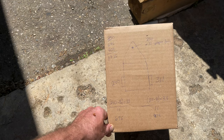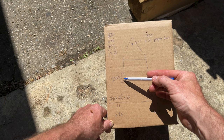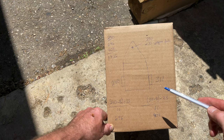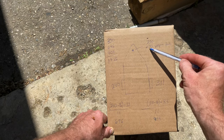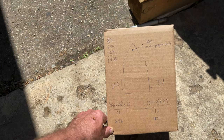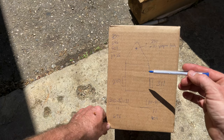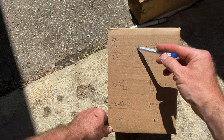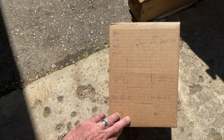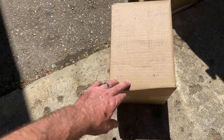So it's rough, not exact, because the tire is outside of the trailer so it's pivoting a little bit outside. There are just a few different factors — it's not an exact science. I'll probably take it across a scale anyway. But this gives me a rough idea of what it weighs and also how much my hitch weight is, because you want to keep that roughly about 20% of the total weight on your hitch so that you don't have trailer sway. So I think it's a pretty good setup. My next video I'm going to attach an anti-sway bar and a new jack. I hope you enjoyed watching and can use it for your own trailer build. It helps just to be able to measure everything with your bathroom scale.